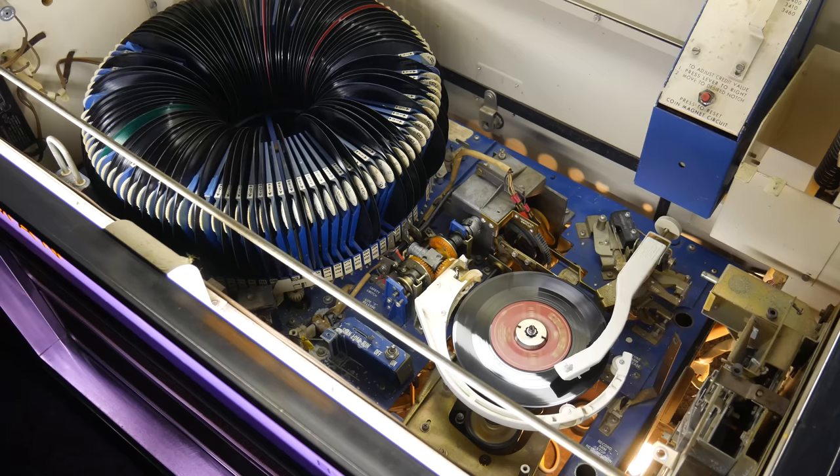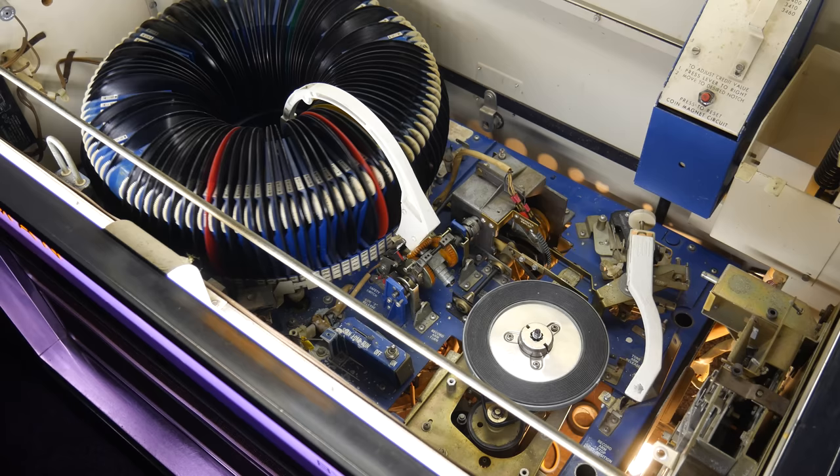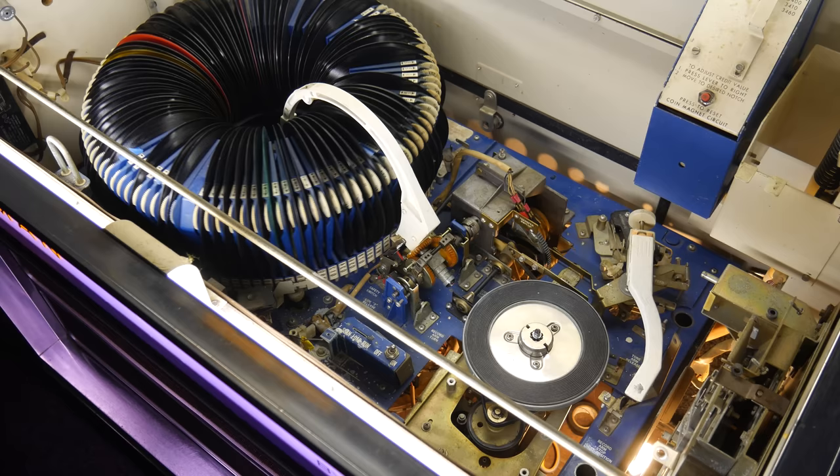Once the main cam has released the play switch, it will keep going on its own, and it lifts up the turntable, or it lifts up the tone arm, puts it back, grabs the record, lifts it off the turntable, puts it into the carousel, and right when it lets go of the record, the transfer switch is released, so power is once again redirected from the main cam relay and back to the carousel motor.